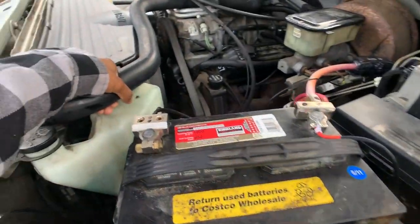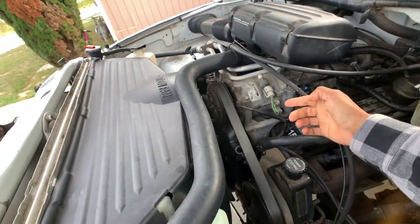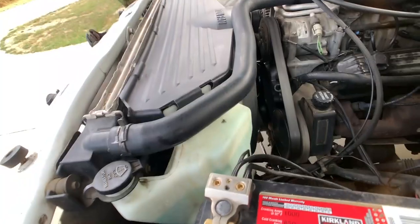Right here is where I'll be putting my temperature probe to get temperature readings. I might also attach one to my AC — the reason it's a good idea is that if you're coming off the highway into the city at 105 degrees and you come to a stop, you won't have as much airflow through the radiator. If you have it connected to the AC, it's automatically going to turn those fans on, which will cool the air and give you colder AC air. But I rarely use AC so we'll see.